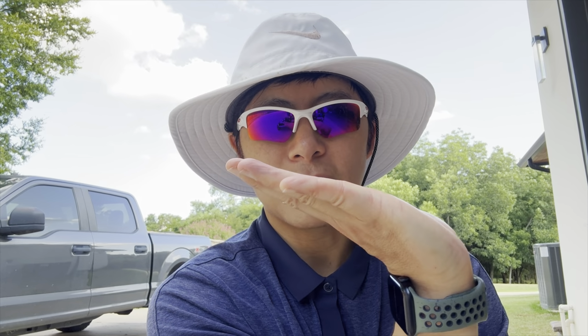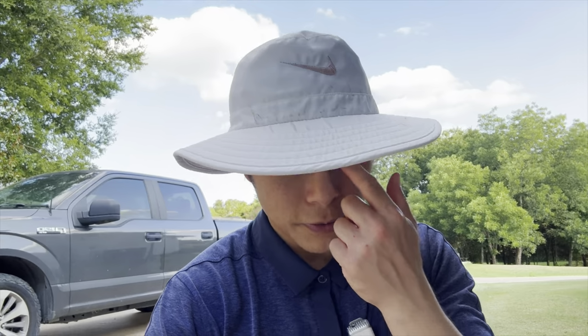In my case, I'm flat like this. He was trying to put a little bit of relief on it, but it's only so much that he could put on it, because there's not much meat left. So unfortunately, my bed knife needs to be replaced, something I learned. He did put a relief grind on my reel, and he also did a spin grind, which is cool. It's pretty much set up to cut really well right now. It's amazing. You can see in the videos that I show that it's a pretty nice and sharp reel now. It's just that the bed knife is not cooperating with it.